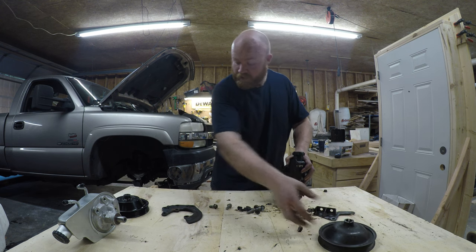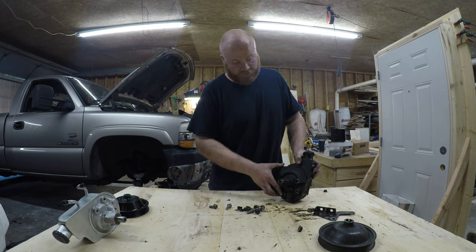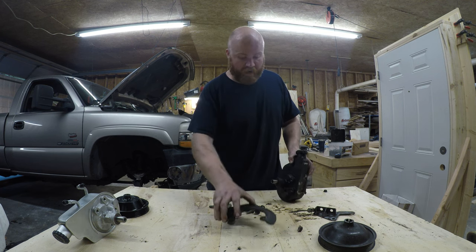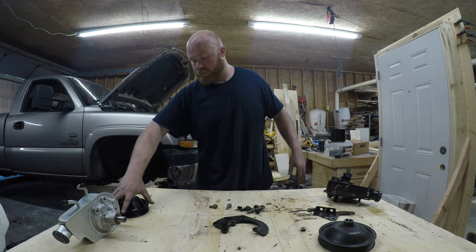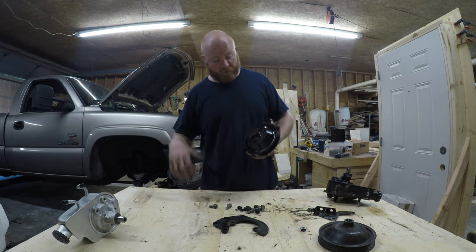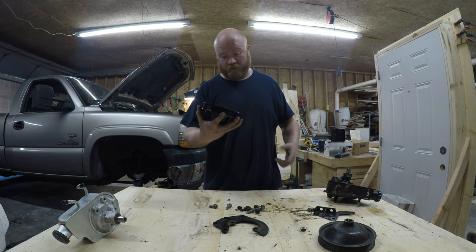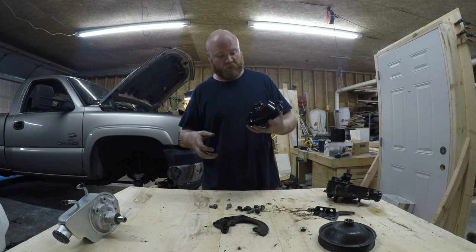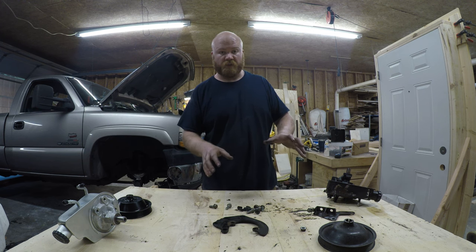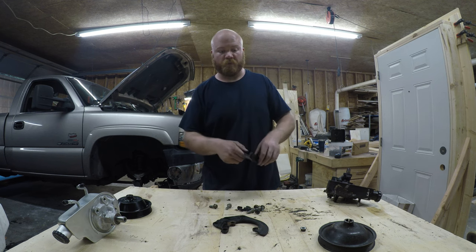Unfortunately, with how this plate goes behind the pulley, you do have to get that pulley off. So do it as destructively as necessary — you need to get it off to get this plate out for remounting. Fortunately, my local AutoZone had this Dorman replacement pulley. It was like $90, but it is what it is — it's a nice machined piece of steel. $90 gives you a nice piece of machine steel, and it is kind of nice to put a new pulley on a new pump. Definitely avoid loosening the nuts, and be aware that you do not have access to the bottom nut until you have removed these two bolts from the cylinder head and removed the pump from the truck.